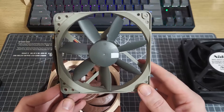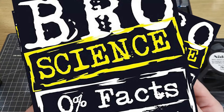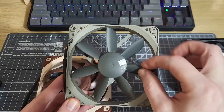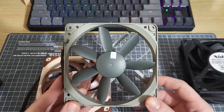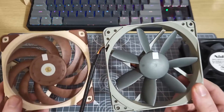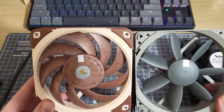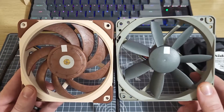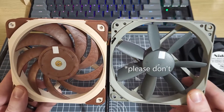There's going to be a lot of bro science around the justification for these designations. For example, look at this fan — look how thin the impeller blades are, and look how much space there is between the impeller blades. Obviously no good for static pressure. Well, in actual fact, the Noctua S12 outperforms the A12X25 in the static pressure test when they're rotating at the same speed. This is, if you want to call it incorrectly, the higher static pressure fan.